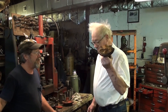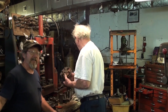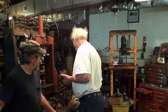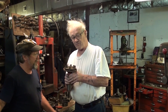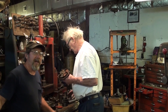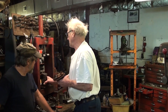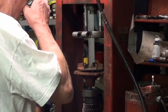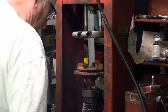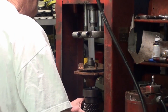I like to measure metric because it's easier. That's because he's an import — he's an alien, illegal too. We set the pump on a tube so the bearing can slide into it, because if not, you'll break it. Before you do anything, put your pump on the bearing on something solid. Put a tubing or whatever over the impeller and break the impeller loose first. Did you hear all that? Break the impeller loose first.